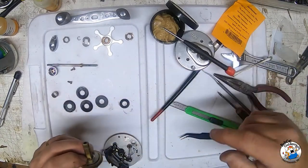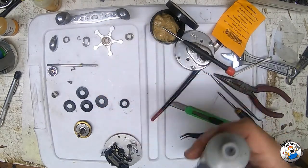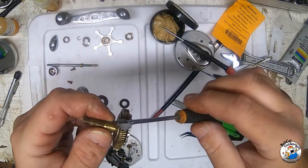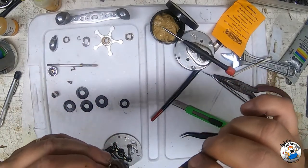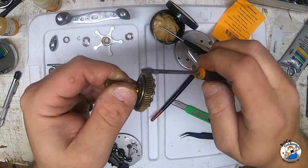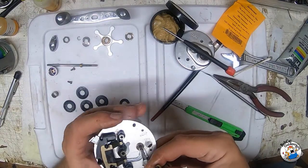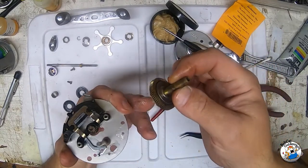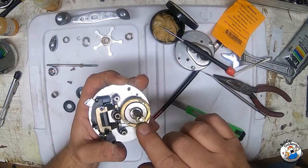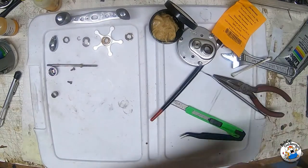Now while I've got this out, I'm going to put a little bit of super lube on that main gear. Just take a little bit on the end of the screwdriver - it doesn't take a lot, you don't have to smear these things up with grease. Just take a little and put it on the brass gears to spread it around. That's plenty. Everything here's pretty clean so we're going to take our main assembly with our drag washers and put it back in, making sure the main gear mesh is good with your pinion shaft gear.